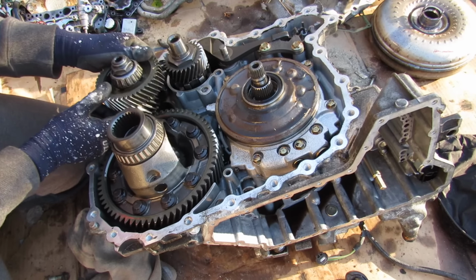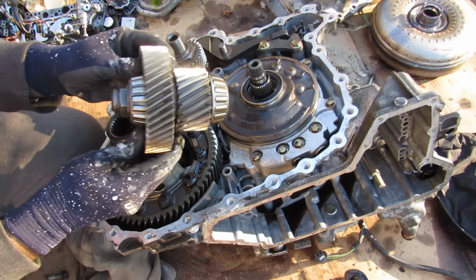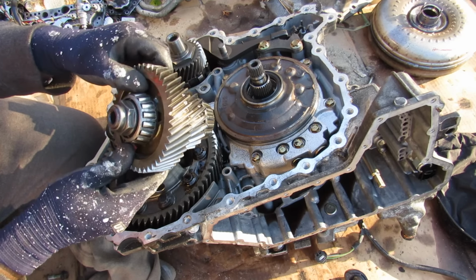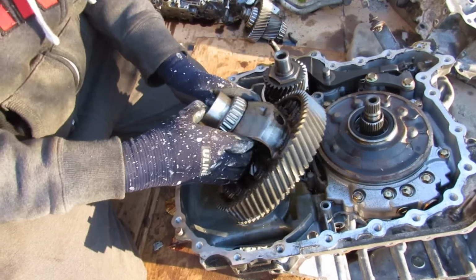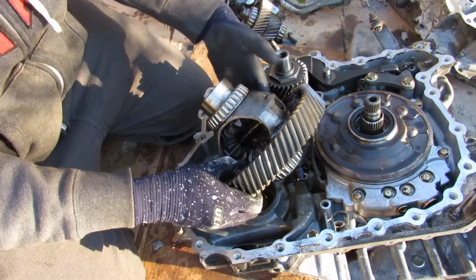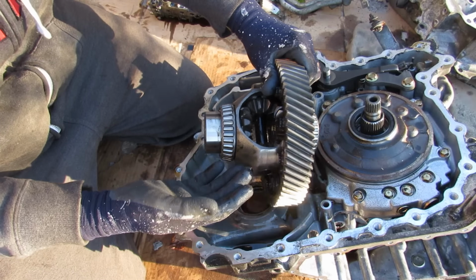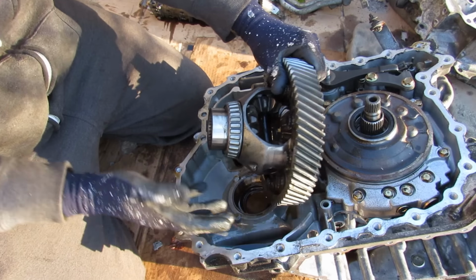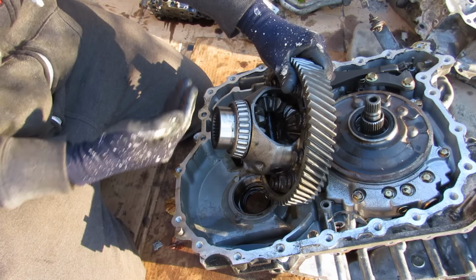Now I'm going to remove this intermediate gear here. You can see that this one's actually got the gears on this angle here, and that's to prevent any whining sound when the transmission is going. Now over here we've got the front differential, and that just pops right off. And I've already got a video on how differentials work, so you might want to check out the description and the link below. The only difference here to note is that this is an all-wheel drive model, which means that you're going to need an extra shaft to feed the transfer case to feed the rear wheel.